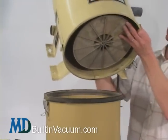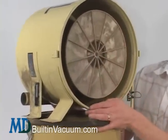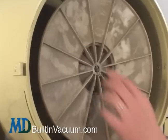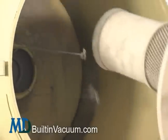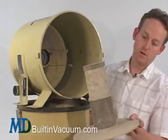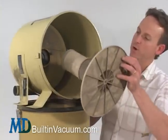The filtration portion of this vacuum consists of this plastic piece right here. Each time the debris bucket is emptied, this should be taken off and cleaned. Just push in those metal clips, pull the plastic piece out, and you want to knock it clean. You're going to find a lot of hair and debris around that mesh area. After you've cleaned it off pretty good, it just slips right back on.